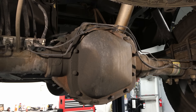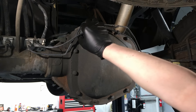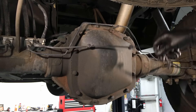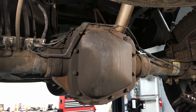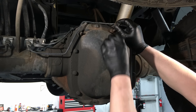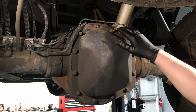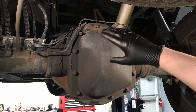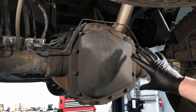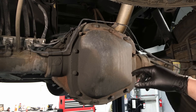First things first, we're going to get anything out of the way of these bolts that hold the rear pumpkin cover on. On this model there's only ABS wiring, so let's pull those out of the way. On some models there are brackets for brake lines and stuff like that depending on your model and year. This one has a brake line and bracket — very common. We're going to keep it in the bracket and just get it up and out of the way. If there's a lot of dirt around the outside, you might want to take an air wand around before you open it up. These bolts are almost always half-inch, not 13mm — that might save you some trouble.